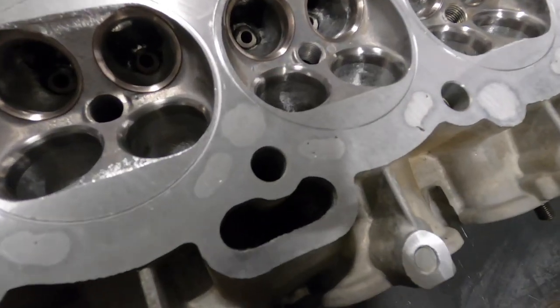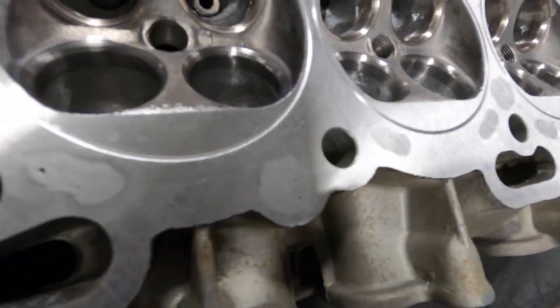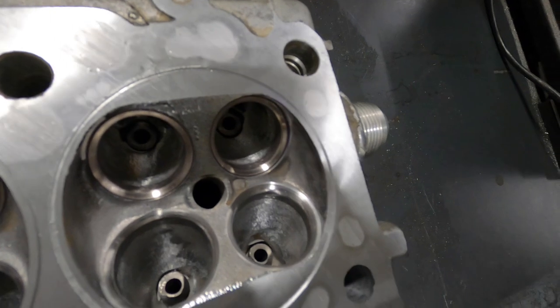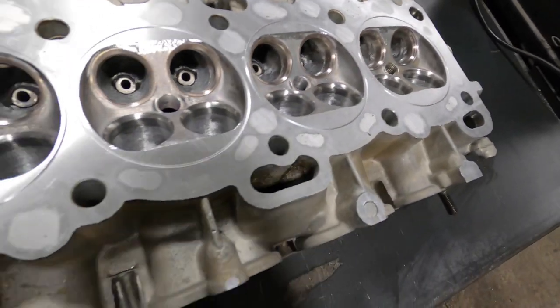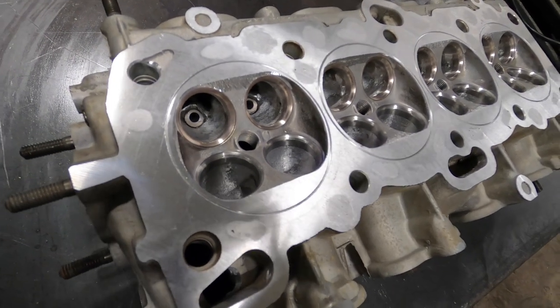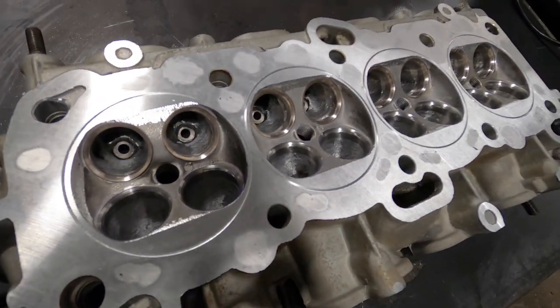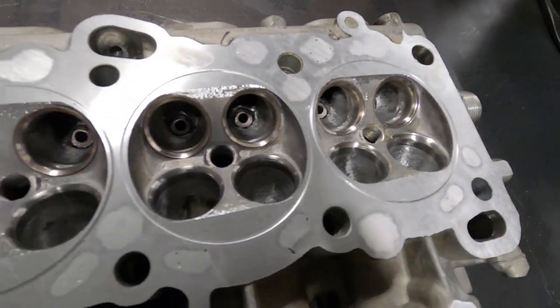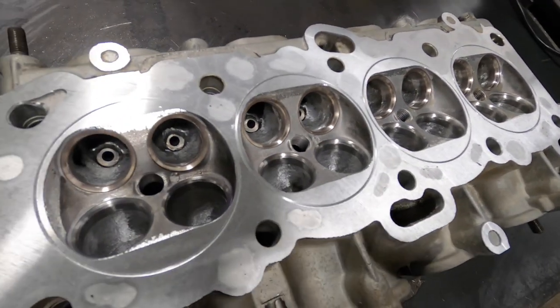All right, got the grooves all cut. Now it's time to lay the O-rings in there and file fit them. That can be quite a challenge to get the ends correct. You'll see I use my ring filer to get the ends right. You're not trying to get a gap at the end of them, but it's super hard, difficult to get them perfectly butted up.